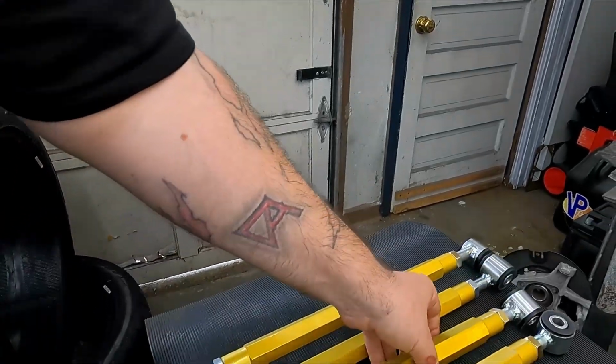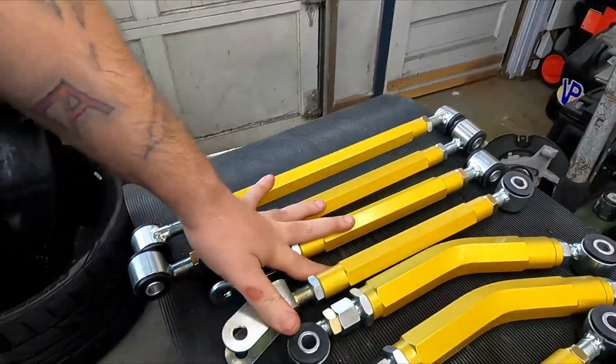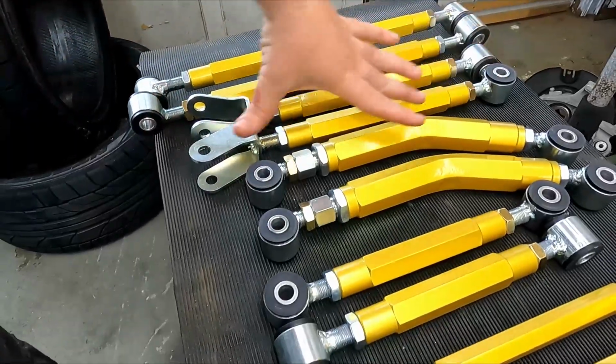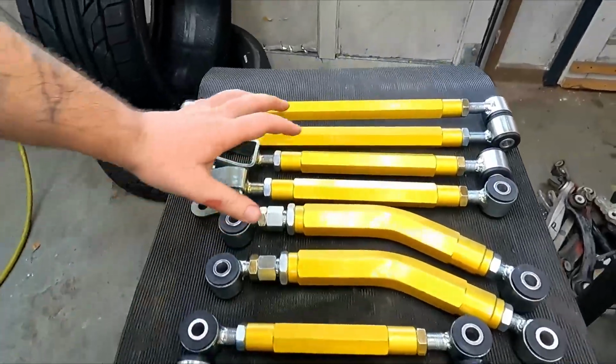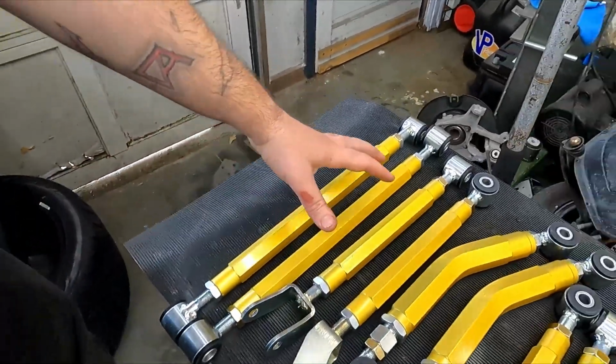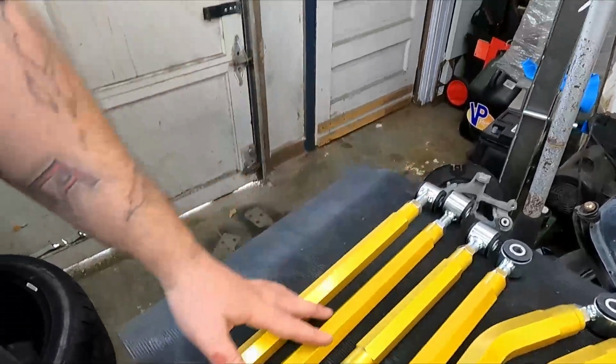All right, all the rear suspension, went ahead and replaced everything. Picked up everything in billet aluminum, and I got everything set to the factory length right now, just referencing the stock parts. So I should be able to throw these on, and from there I'll be able to dial in the suspension. I'm really not sure where it's gonna sit as far as ride height, based on body to ground of the Charger versus the Renegade. I think I got the frame sitting a lot lower than it did on the Charger, so I'll just have to tweak everything.